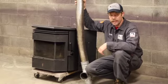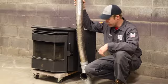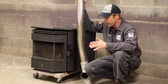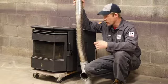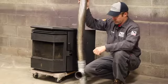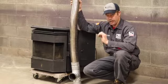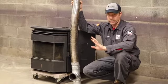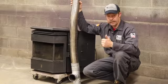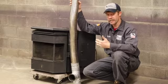Now we're going to cover the traditional pellet stove annual service and maintenance. Customers will call and say my pellet stove isn't operating correctly, or it's just time for annual cleaning. A lot of chimney sweeps will simply clean the venting, which is great, but it's really the last of four things we do on a pellet stove. There are four things we always do: we clean the combustion blower, the convection blower, the ash traps, and last but not least the vent.